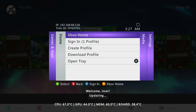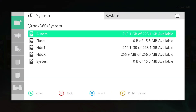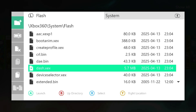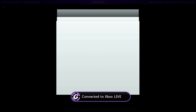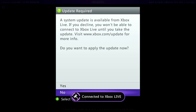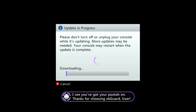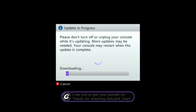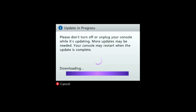Now let's head over to the XBGuard Dashboard. Go to File Manager, open the Flash folder, and launch dash.xex. This will take you straight into the XBGuard Stealth Server Dashboard. And boom — the system hits us with the Kinect update prompt. Go ahead and click Yes and let it do its thing. The update usually takes around 10 minutes, so grab a snack and let the console work its magic. Once the update is complete, the console will automatically restart itself — no need to press anything.